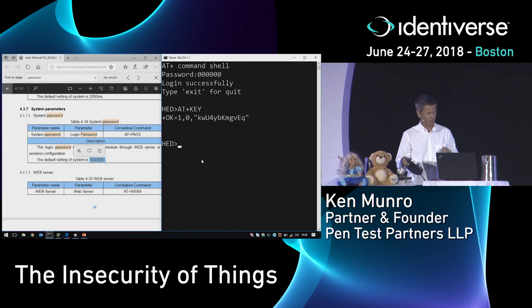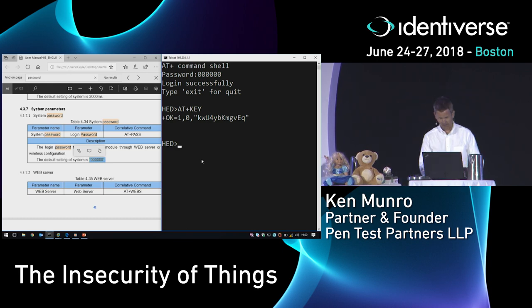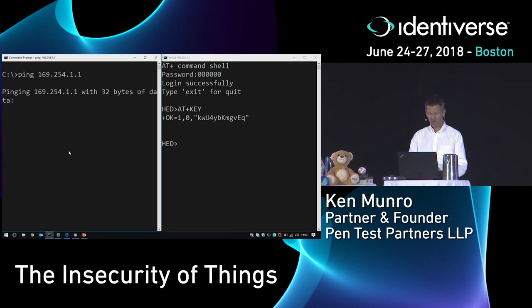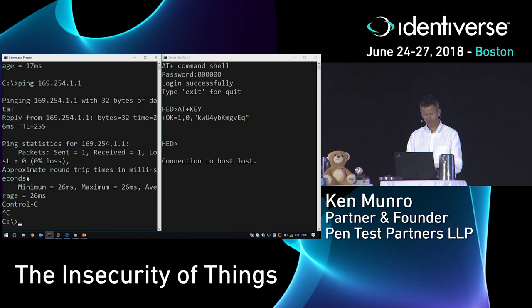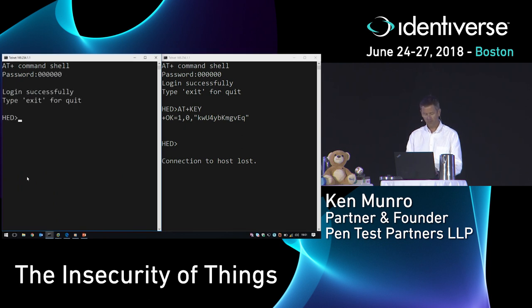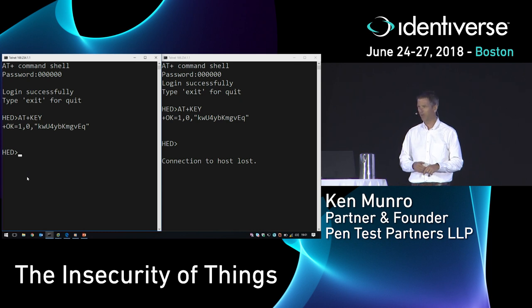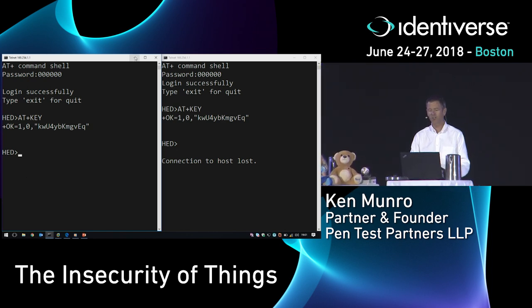And then there was something really nuts. I wanted to look at resetting the kettle — what would happen with a factory reset? You hold down one of the buttons for 10 seconds and wait for the kettle to restart. I connected back to it, and the Wi-Fi keys survived a factory reset. That means I can go onto eBay, buy second-hand kettles, and buy your Wi-Fi keys. And because the sender puts the return address, I know where they live too.